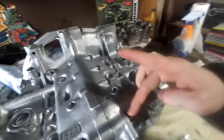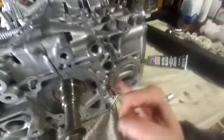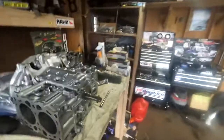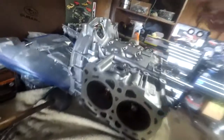All the small bolts on the outside are going to be torqued to 20 foot-pounds — the spec is like 18 or 19 but I do them to 20. All the big ones on the inside, like these here and the ones inside the coolant jackets, those are going to be set to 35 foot-pounds. You start in the center and work your way out in a circle on both sides at the same time, just like any other torque sequence.